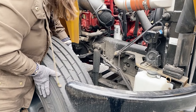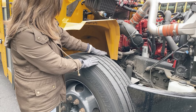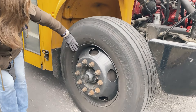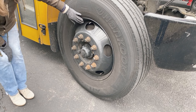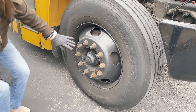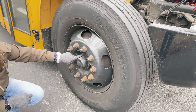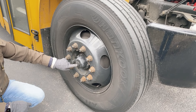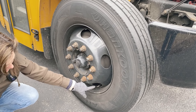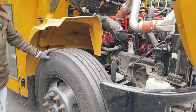The outside and inside of my tire has no abrasions, bulges, or cuts. The tread depth is 4/32nds, evenly worn all the way across. The rim has no welds other than factory and it's not cracked or broken, loose or missing. All of my lug nuts are in place and tight, bolted and mounted securely. The hub oil seal is in place, bolted and mounted securely, not cracked or broken, loose or missing. The level of fluid inside is adequate. The valve stem is straight, centered, and has a metal cap. If I were to check the tire pressure, I would use a tire pressure gauge. This is my mud flap — it's bolted and mounted securely, not cracked or broken, loose or missing.